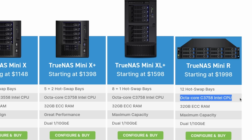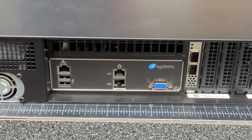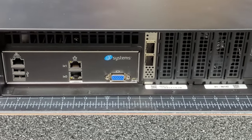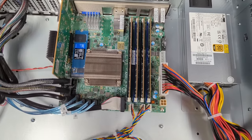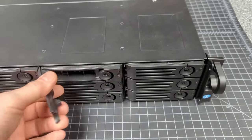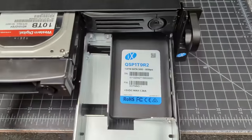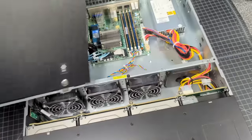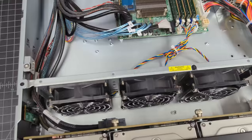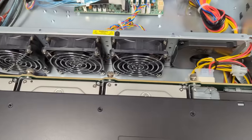You can get 32 or 64 gigs of ECC RAM. It has a dedicated IPMI — we'll dive into that shortly. The networking on board is two 10-gig RJ45, but it does have a PCIe slot you can use for SFP+. It has one M.2 NVMe boot device and 12 high-quality lockable hot-swappable drive bays, though you can put 2.5-inch drives in there as well. The unit has a 45 dB idle and 52 dB peak noise level, so it's welcome in my studio without annoying me — a good sound profile, and much quieter than a lot of other rack-mount equipment.